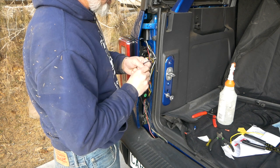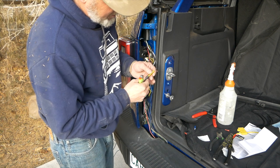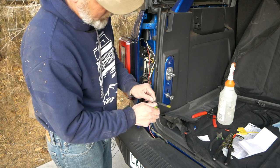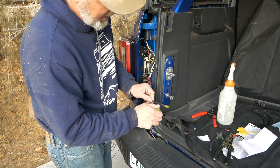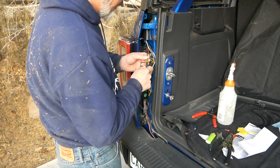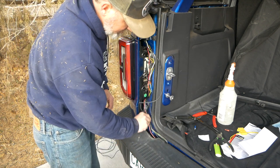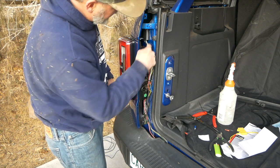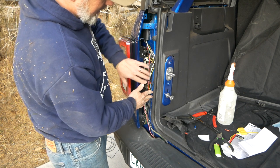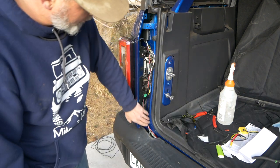All you have to do is use the connectors that came with it — it's actually a really good connector that'll hold really well. I'm going to put a piece of heat shrink tube over the top of that. The fact that I'm putting this connection behind the tail light means I don't really need to do this, but I'm doing it because I have the materials. I'm going to do the same thing — slide the wire in there. Now that is nice and tight, and because we put the modulator in, this is actually out of the weather for the most part, tucked inside of here. I'm going to connect it to the rest of my wires here, and there are my wires all tucked nice and neat. Now we're going to put our cover back on.